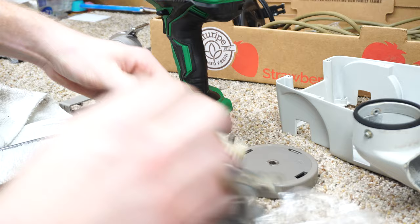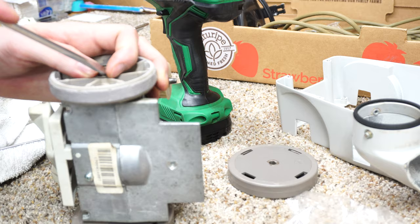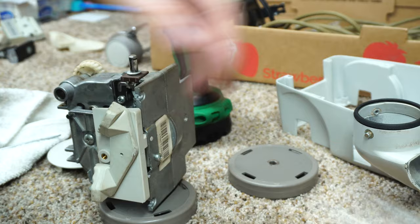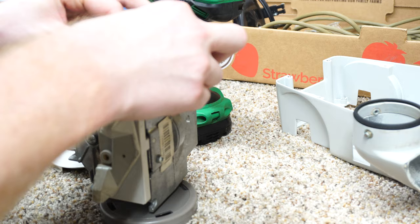You can see the colors are just right on. When we release this, just pop that off as well. You can use a snap ring tool - I found the screwdriver is usually a little bit more precise and less springy with this particular application. There we go - e-clips on.